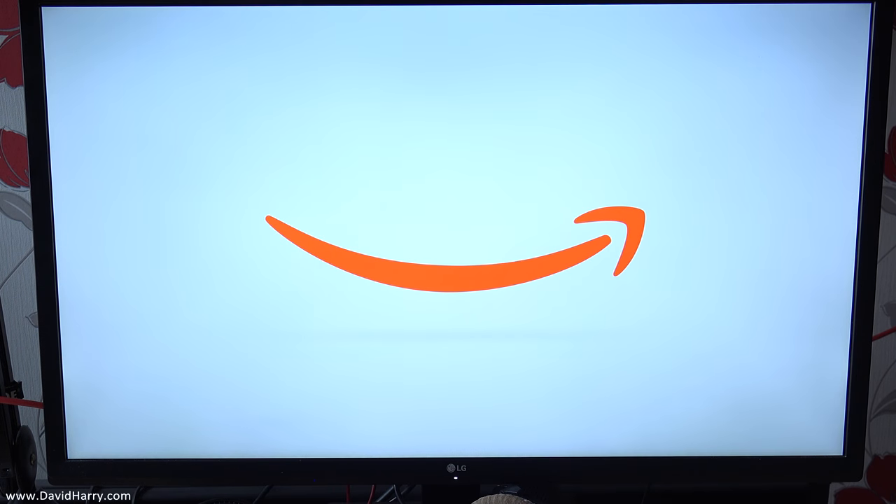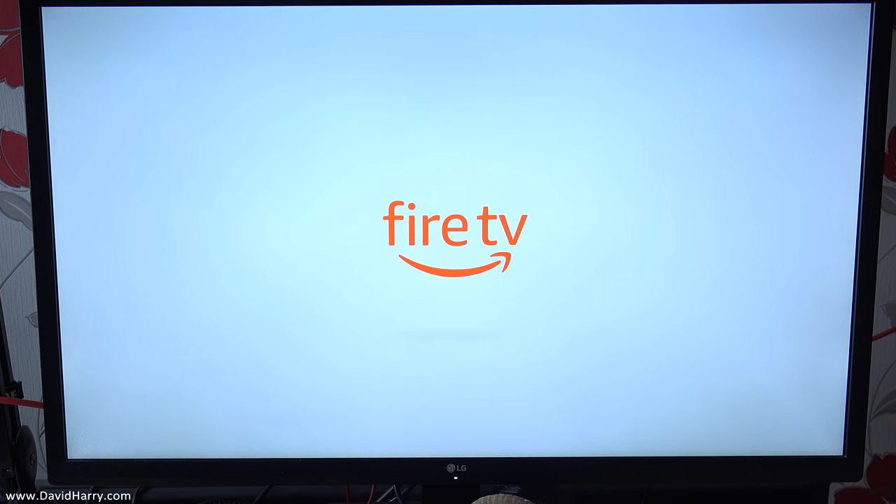It could be the case that all you need to do is swap out the USB cable connected from the Fire TV Stick to your power supply, or even swap out the power supply, because sometimes it's just them that's broken. But if yours looks like this, it is highly likely to be the boot loop. The process I'm about to do is basically going to put the Fire TV Stick 4K into safe mode, and then I will do a reset.